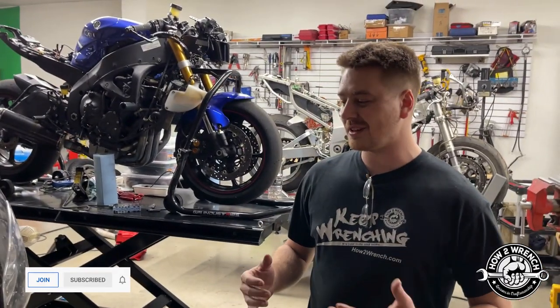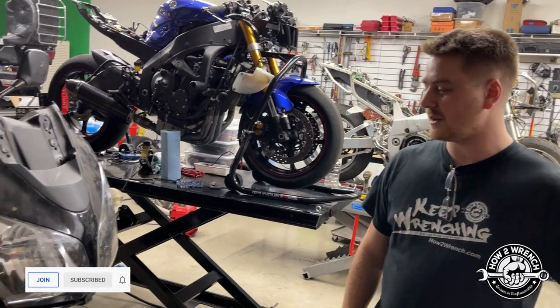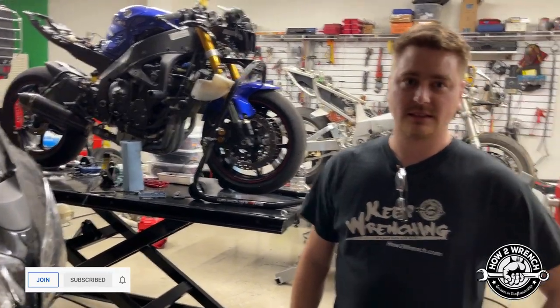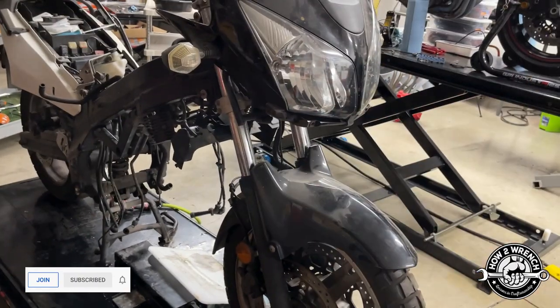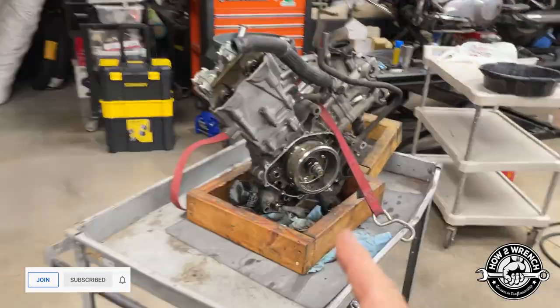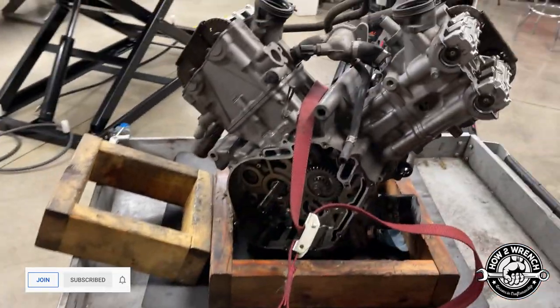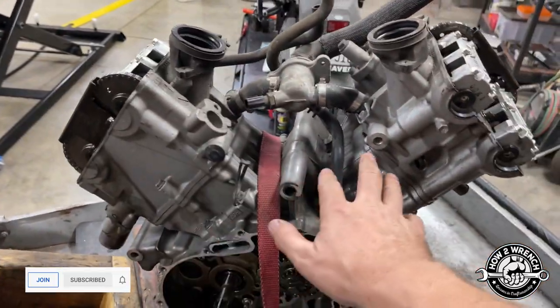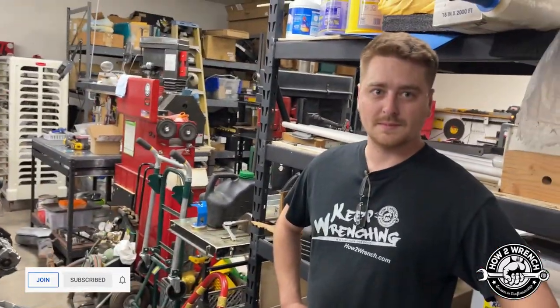The coolant was a bit of a surprise — it seemed like it was good at first, then it slowly leaked more and more. We hunted for a while trying to find it and were unsuccessful, but we know it leaks. The downside to the coolant leak means it's internal. We've got a 40-some-thousand-mile motor — hopefully it's just a very slight head gasket leak — but good's good and bad's bad.